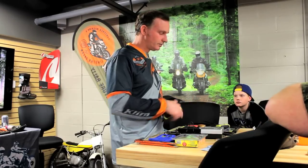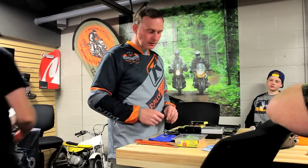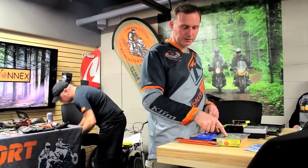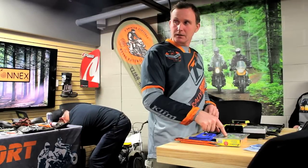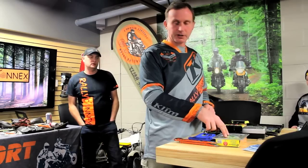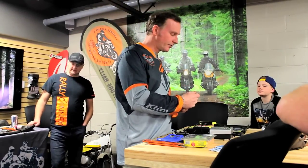That will plug the hole, then you need a way to inflate it. So, Kevin, you were saying one of those big 45-gram CO2s will pretty much do an adventure tire, with possibly a little left over if you're lucky. Probably not. So a rear tire, a 150, that'll do the tire. One-time shot. One time, yeah. It's been packed and it's foiled over.